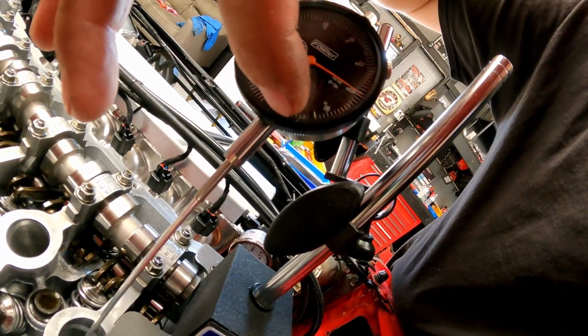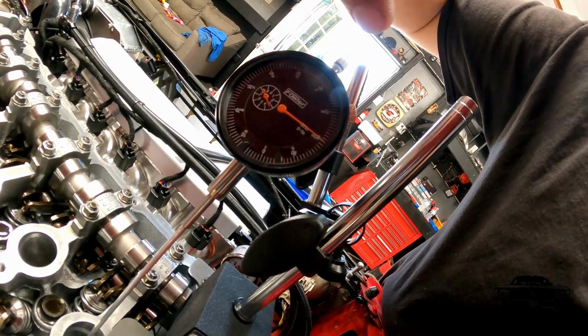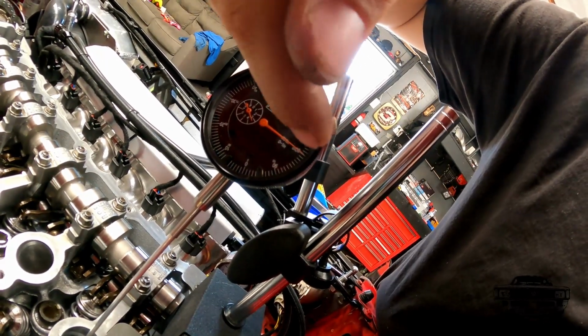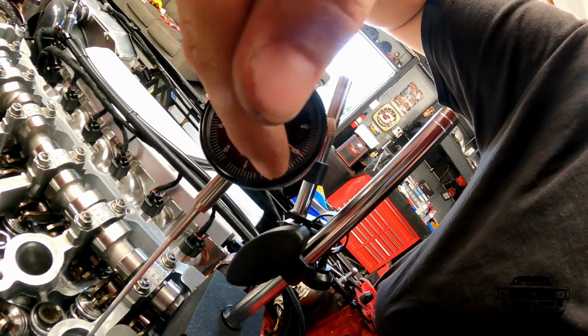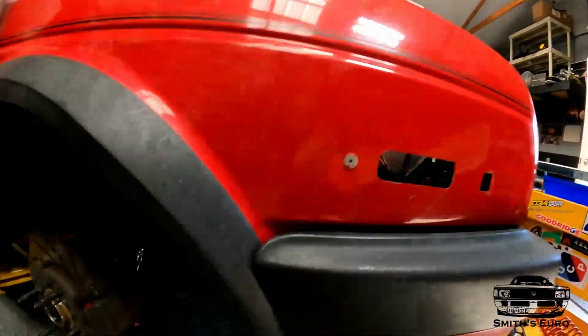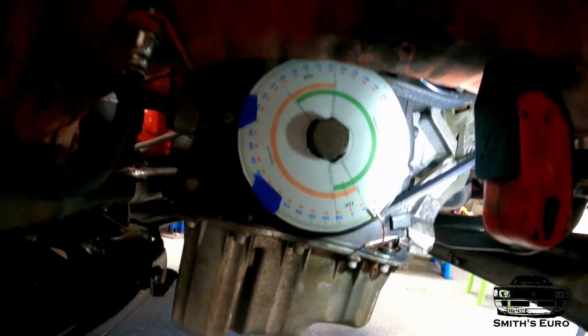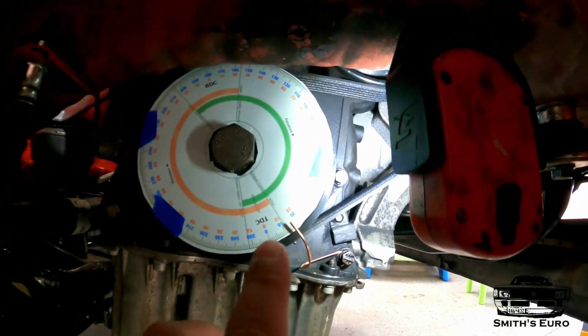But you start at 0, and then you go one direction until it goes to like 20, and then you go back the other way until it gets back to 0, and then it comes back and gets back to 20. And then you take those two numbers down on your degree wheel, which I have down here. I just printed out one. I'll have a link in the description for that, but it works really well.